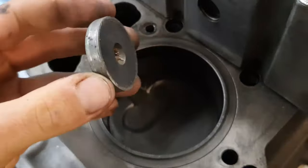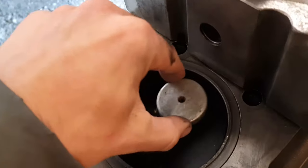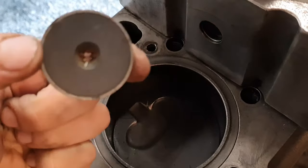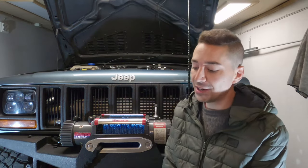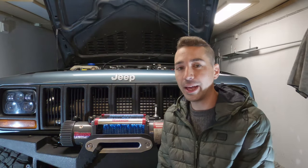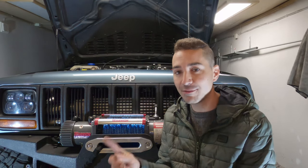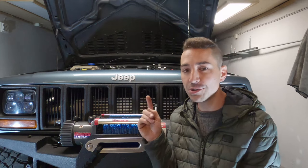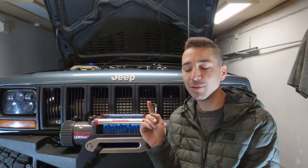It's got cast alloy pistons, basically. So when you're looking at that already, there's going to be an upper temperature limit that they're going to be able to handle before they melt. You're going to have to keep an eye on your EGTs, and you really do need a pyro gauge, and you need to drill and tap that exhaust manifold, and you need to have that pyro gauge all the way back as close to the exhaust exit port on the cylinder head on cylinder number 4